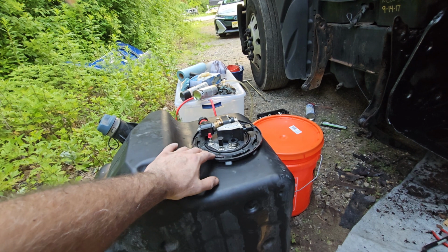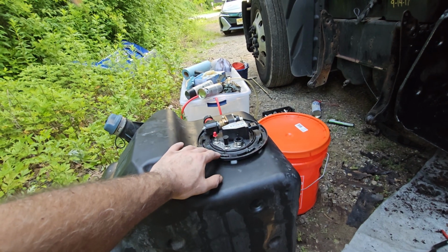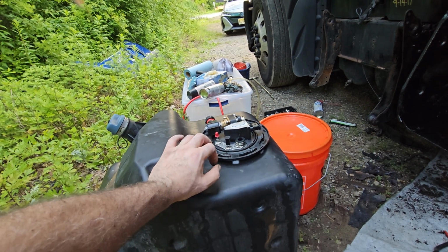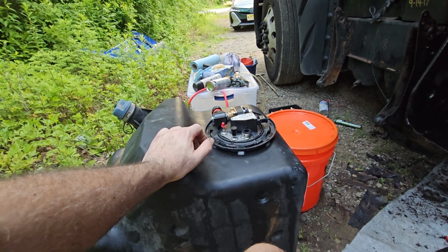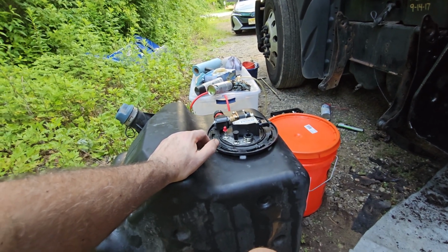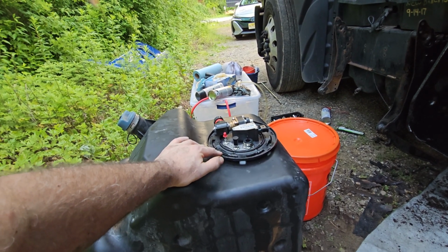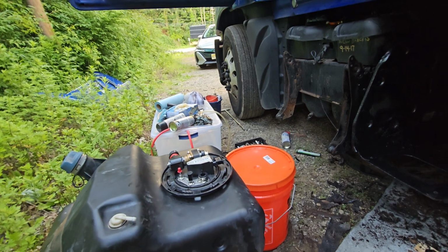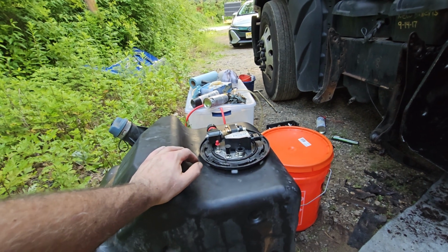What it was doing is that it was misreading. I had a full tank of DEF, and a couple of times the driver ran out of DEF, and it was showing the amber LED on the DEF sensor, the gauge there. I immediately knew what was going on when he called me, and I said, "You ran out of the DEF." Sure enough, we put the DEF in, and after a couple of tries it was still derated. We had to do the regen. So we did the regen.